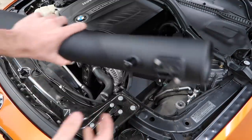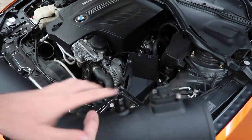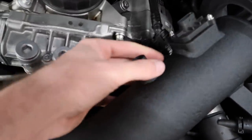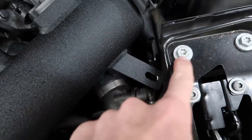Now I have the actual pipe itself, the intake, and I also have the sensor screwed in. They actually give you new bolts and new washers for this, which is really nice. Now we have this heat shield on. We're not actually going to put on the next heat shield yet — we're going to install this little intake pipe first. We're going to screw that down and then take off this little grommet here. There's something sitting on top of it that we took off so we can plug it back in. We need to remove that bolt, then we can start lining up everything.